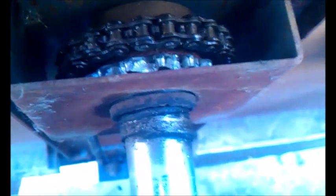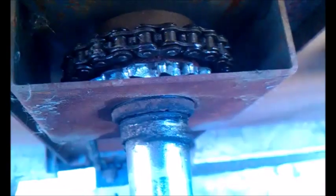So I'm going to raise the roof, and to keep it up, that silver one should stop and hold it up. But you can see it's going down. So the brake pad mechanism is not holding the roof up. And this is purely from contamination. Now I'm going to try to get it backed out so I can clean it. But right now the extension tube is jammed on there. Somebody strong cranked it up.